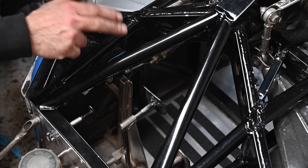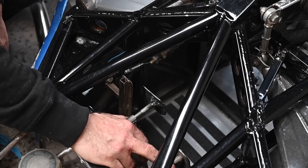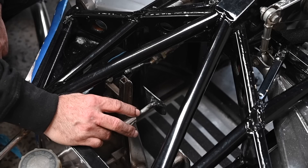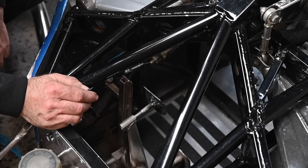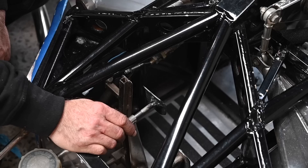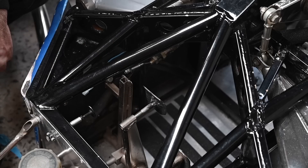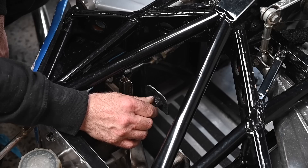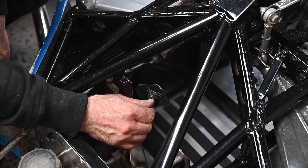So here we've got the throttle, the brake, and the clutch, and it's a bit difficult to reach. I'll have to extend these pedals. I could move the whole pedal box forward normally, but on this car that doesn't seem to be possible, so I'm not going to drill bigger holes in the frame. Instead I'm going to extend and rework the top parts of these pedals. Let me take one out and show you how it's going to look — I've already made one, and then we'll make one together.